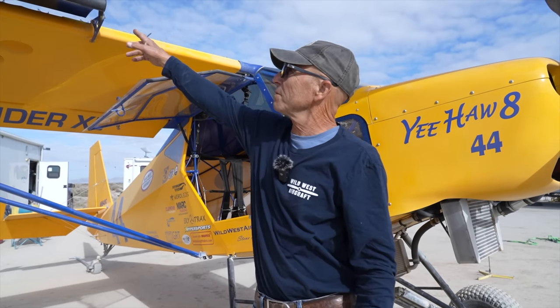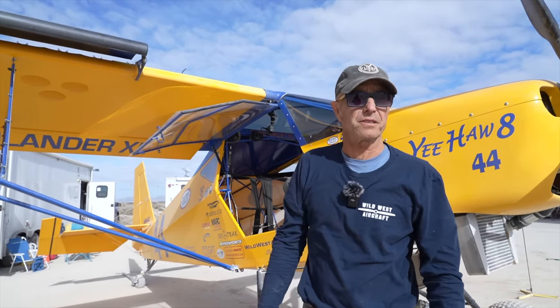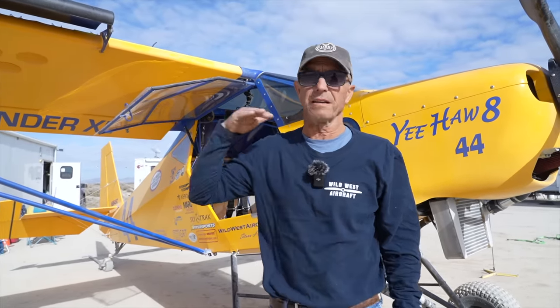One thing that's really cool though that I'm really finding out, it isn't all about the power. It's really not. I mean, even with it turned down, it is almost as fast, because I can stay on the throttle longer. I find it's a little bit easier to predict where to pull the power doing it this way. This is the first time I've ever run my slats in a STOL drag. I always just figured, why would I want slats in a STOL drag? Because I'm not about landing slow. It's just about making everything happen as quickly as you can. But I think the airplane kind of does slow down a little bit better when I'm wanting to slow down.